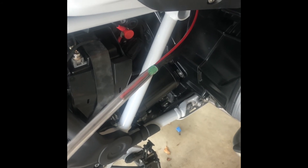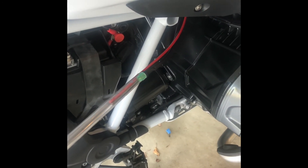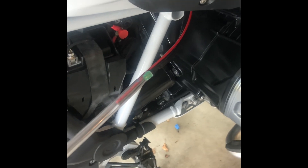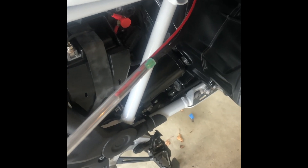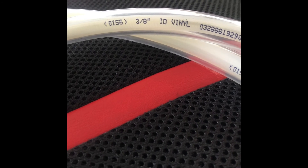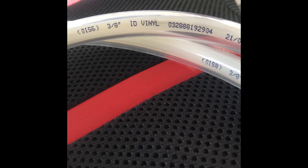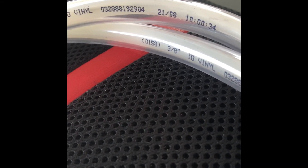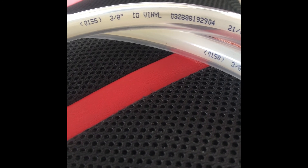We have success — that's fantastic! That took five minutes. Last night I took an hour trying to get that stuff through and actually got the data cable stuck in there. I called Billy and he said if I wrecked the data cable he'd just get me a new one, but this worked fine. In case somebody wants to try this, this is 3/8 inch vinyl tubing, which I got at the hardware store for my condensate pump. Man, it worked like a charm — unbelievably quick and easy.